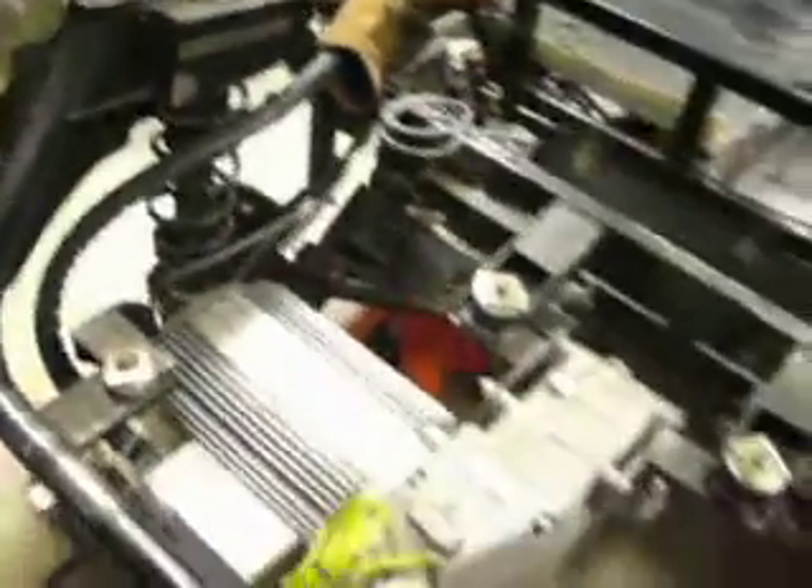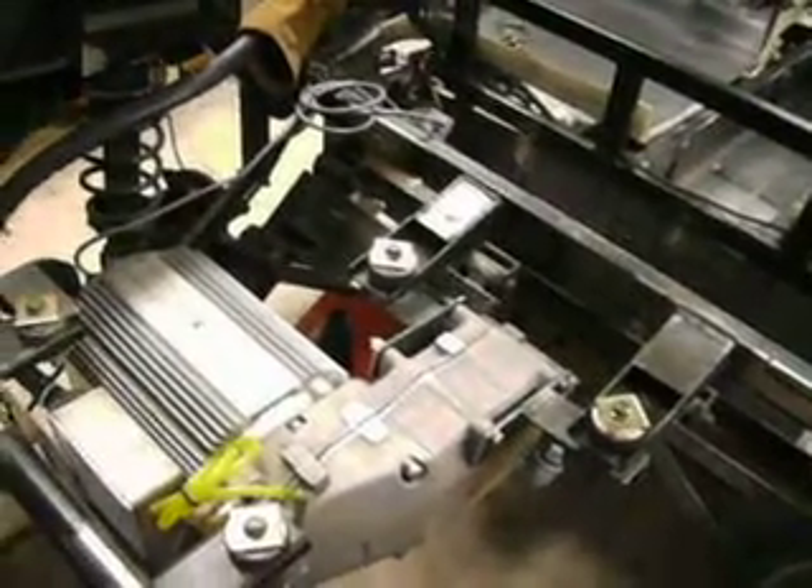We've sent out for the axles — I measured those up. We're using the original axles, shortening them an inch and a half. And pimp Smack style, we're going to have air ride. Expecting the air cylinders to get here any day, so this vehicle is going to have air ride to adjust ride height, because there is going to be significantly more weight on the vehicle than originally designed.